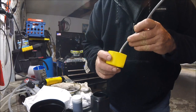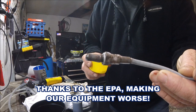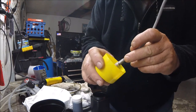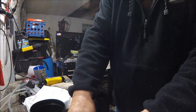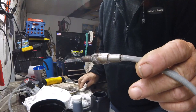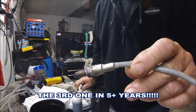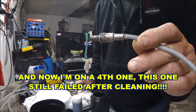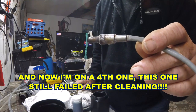That 3-6 alarm means it's the O2 sensor — and there's the O2 sensor out of my 250 Suzuki. I'm sitting here right now soaking it in oven cleaner to decarbonize it. That's usually the problem. Although this was recalled, and this is now in what — five and a half, maybe going on six years. This is the third O2 sensor out of my 250 Suzuki. They claim the last one was bad, and on March 4th of last year I got a new one put in.